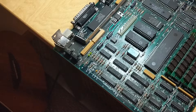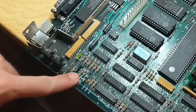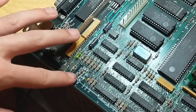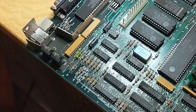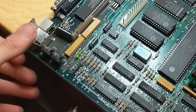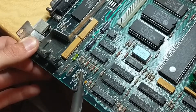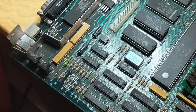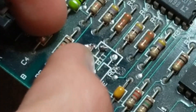So the next thing you're going to want to do is cut or desolder this resistor. Somebody either cut or desoldered it before to make it 4 megabytes and then re-soldered it. I'm going to need to desolder that so I can actually use this board. Forgive me for my horrendous soldering skills. There we go — it is loose and free.